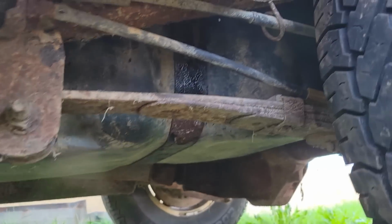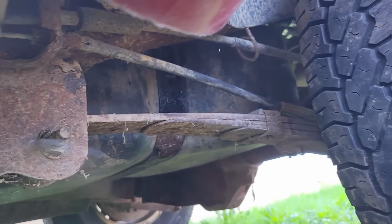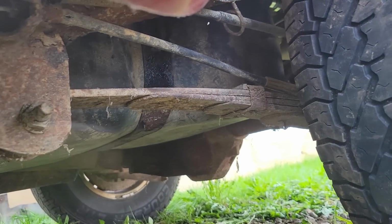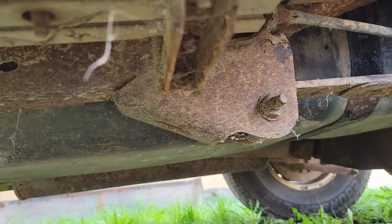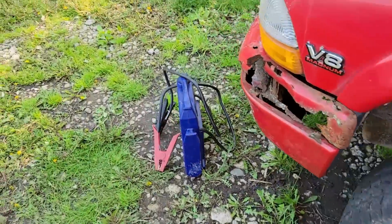She's up there. Got my new straps in. Both of them are up there. Got the vent hose over there hooked up. Got the vent and fuel hose in over here hooked up. Got the sender plugged in. And the main fuel line plugged in. Let's do some final checks here.